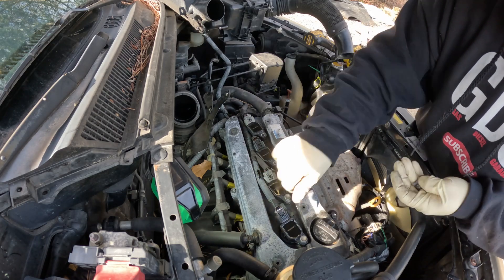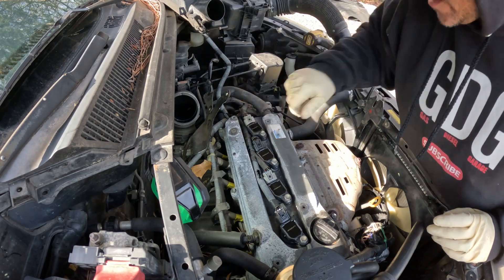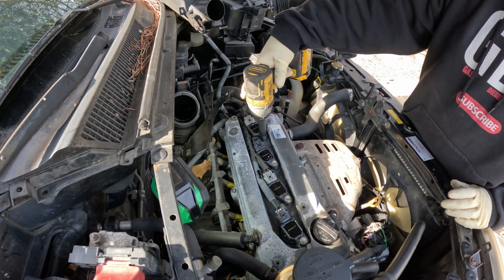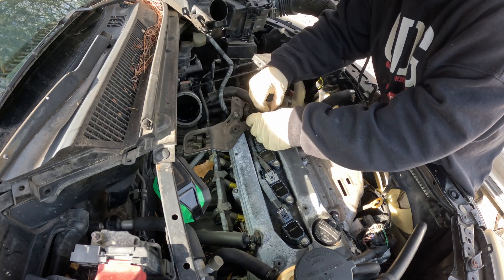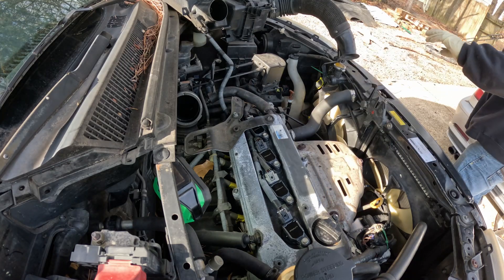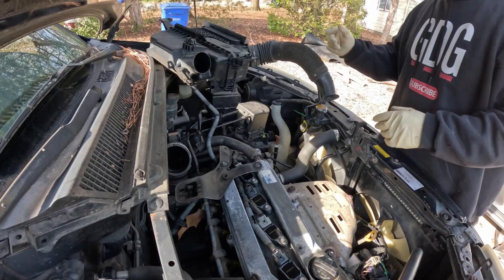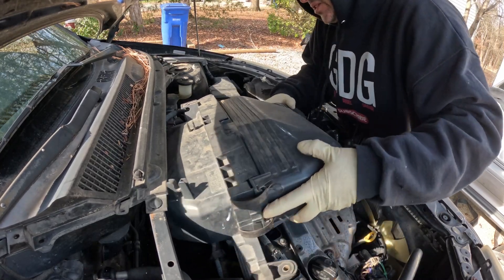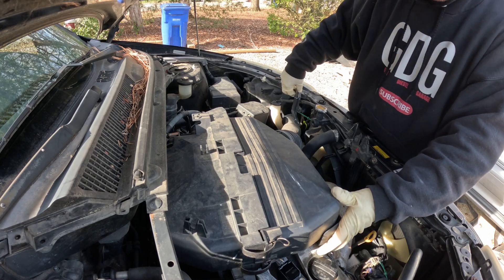These you can use an electric impact or an air impact on, but don't go crazy because you don't want to snap these things either. Put the mounting plate back on for the intake — that covers the number 4 ignition coil. Throw the intake back on, make sure you go hose first because you don't want that mass airflow sensor code to come up, because then it really won't work very well.